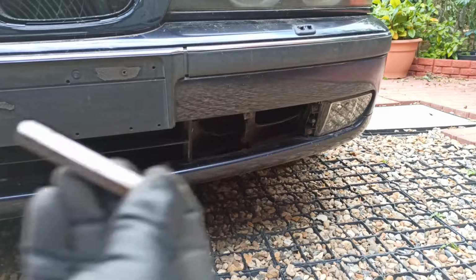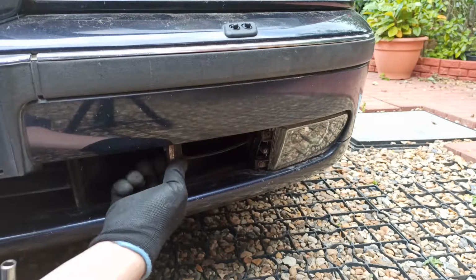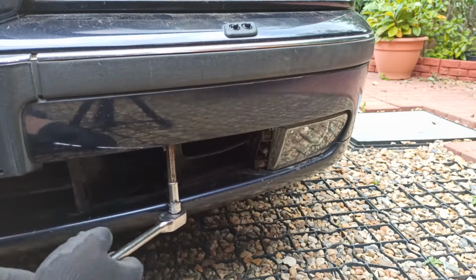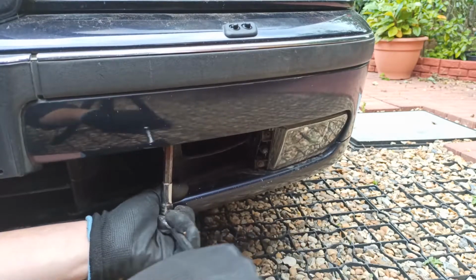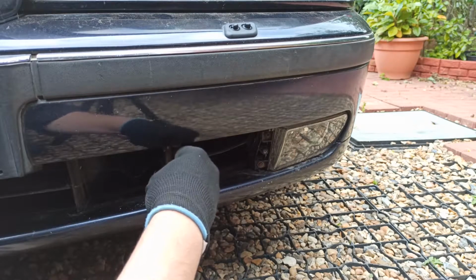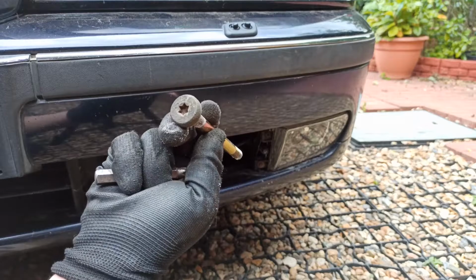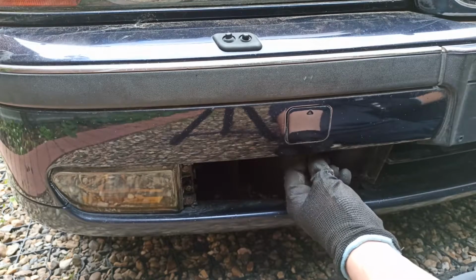To remove the bolt, you need a T50 Allen key. This screw is a little hard to remove as it has oxidized, but you could always use WD-40. Once loosened, remove it using your hands. I wouldn't suggest you use a battery powered tool or an air tool, as there is a high chance that the Allen key will slip and this will make your job a lot harder.